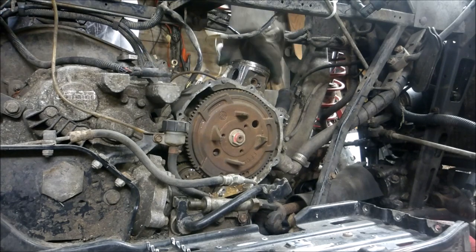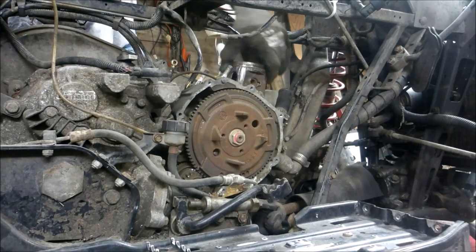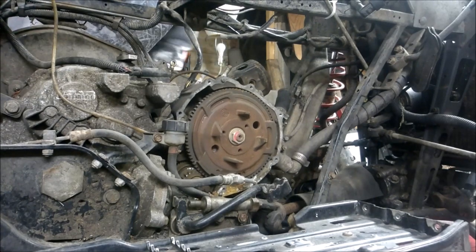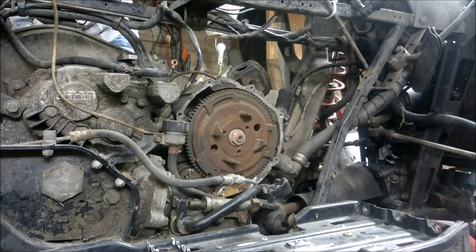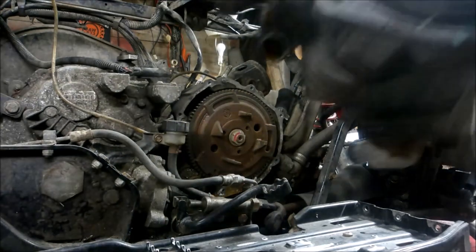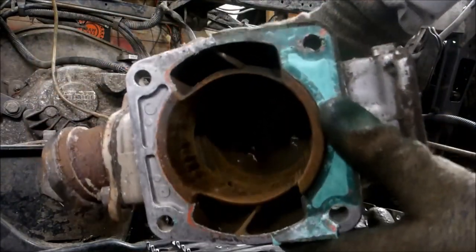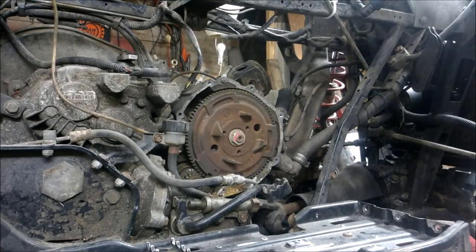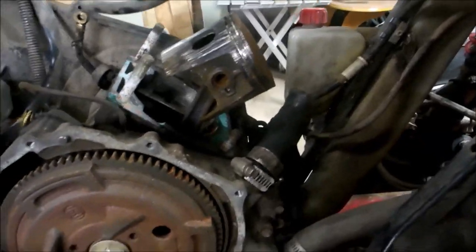A little rusty — it's been sitting for a while. Bearings in the piston are shot; that was probably the major issue. Bearings everywhere. I'll show you the inside of the jug — it's black, carboned up. This thing's been sitting for a while, that's why the jug's rusty. That's pretty bad. The piston's pretty chewed up, rings are fried. That's a shame — the guy went through all this work rebuilding the thing and it blew apart.